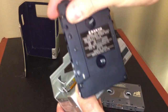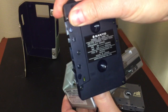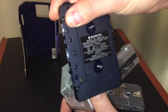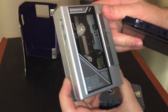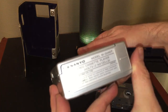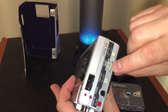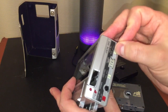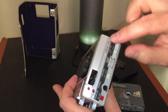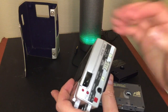The thing you'll run into with these particular units is that due to age, a lot of times the motors in them are wearing out — and that's exactly what is happening with this one. You can see this part has a different model number than the unit itself. This is model number MGR110, and the unit itself is a Sanyo M-G34DT. It works off of two AA batteries. The cool features include a separate volume control for both left and right channels, a metal/chrome selector and normal selector. Metal tape must have been a big deal back then — though I've always found chrome to be just fine.